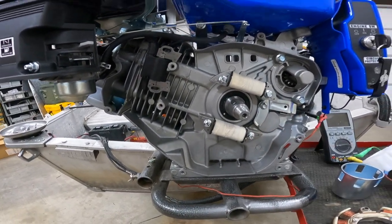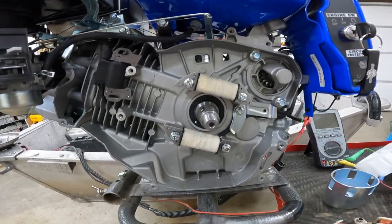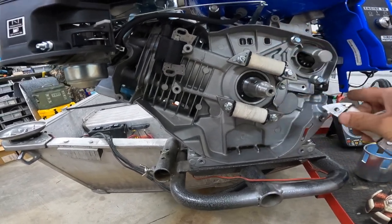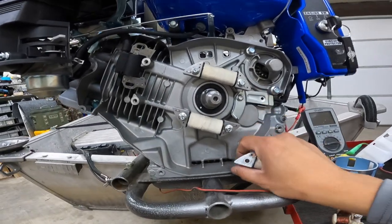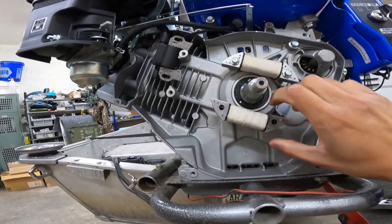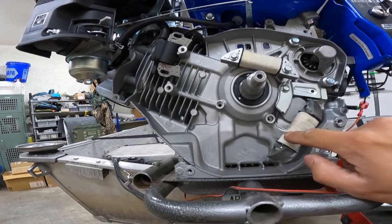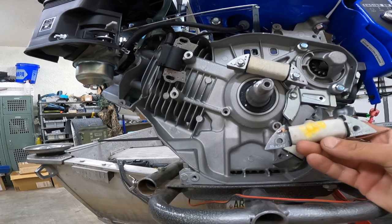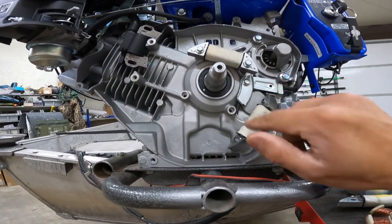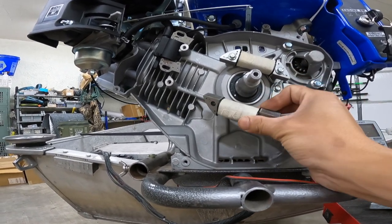The major difference between this OEM Honda coil and the original coil is important. A lot of people just add another basic coil to the bottom — that's just one wire. But this OEM unit is two coils that already come spliced together from the factory, and these coils do not ground out to the chassis. The internal wiring uses two wires that don't touch the frame, whereas the stock coil has one leg grounded to chassis. That's why you need this system with a voltage regulator to really get better amperage out.